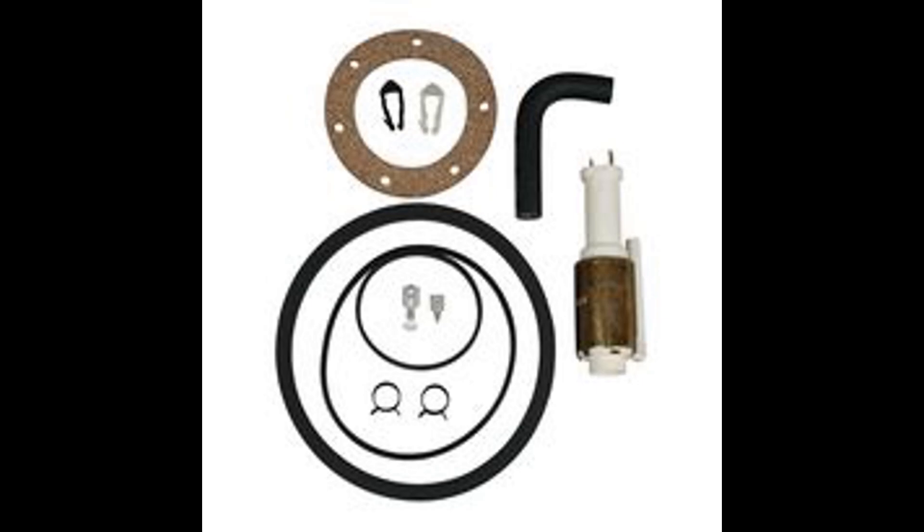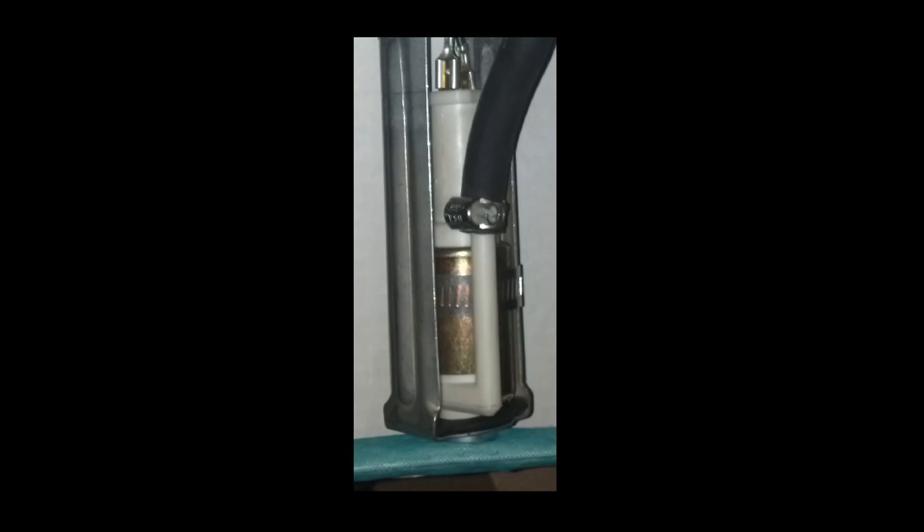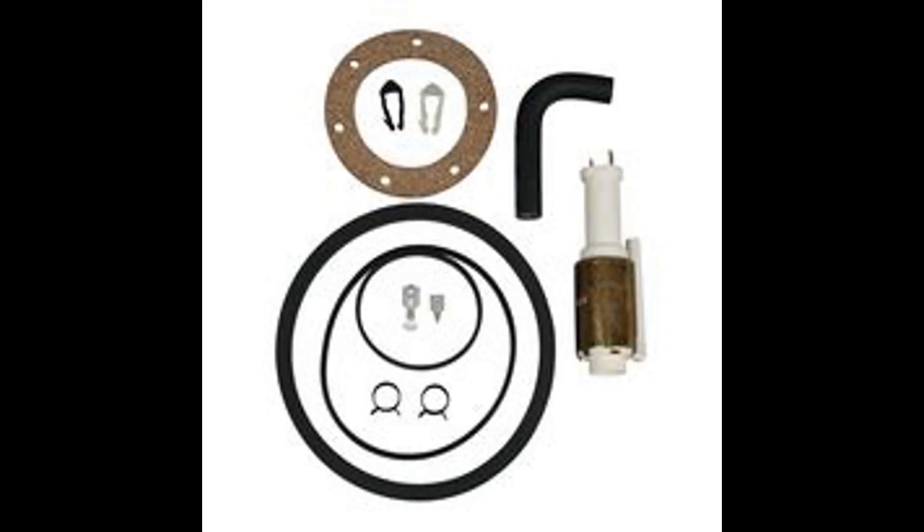This falls into the range of the Airtex E-2484 electric fuel pump, which supplies 50 gallons per hour at 5 to 8 psi. This gives you the required rate, and then some, in case you decide to increase the horsepower of your engine or fuel requirements increase. This pump is smaller in diameter than the factory in-tank pump, but it will fit. I secured the pump assembly simply with a hose clamp. Everything else you need to drop the fuel tank and make the change is included with the pump.